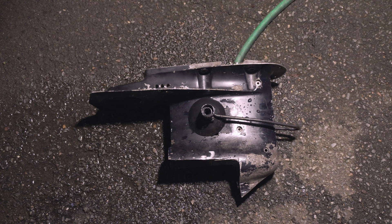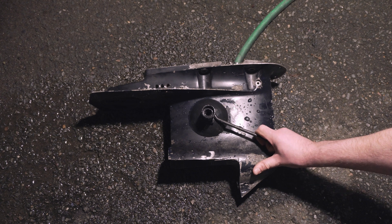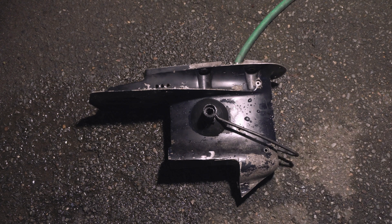That's pretty much why I wanted to make this video. Just watch out for this, especially part two. Most importantly, just turn on the water so it's flowing steadily and keep an eye on it. If you have more than one person helping you, have one person stand there and always keep an eye on the engine to make sure water is actually coming out. Because if the water is not running through the engine at all, it can overheat very quickly and you can burn your motor up in your backyard. Just a quick tip — something very simple to watch out for. I hope this helps.